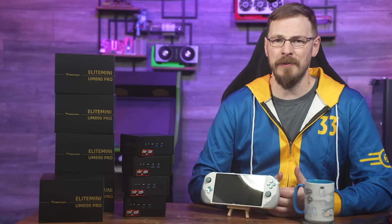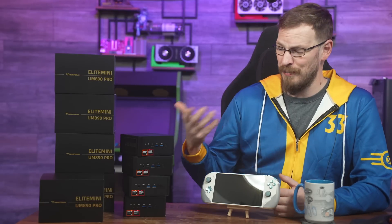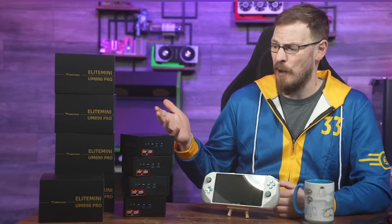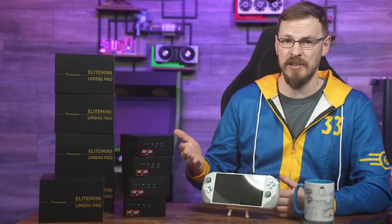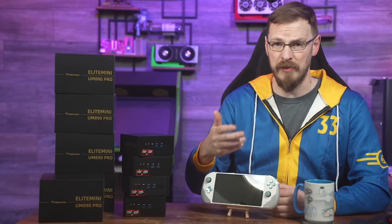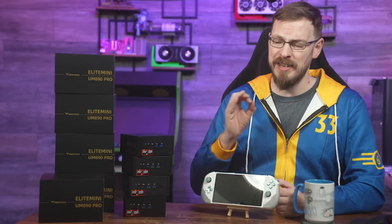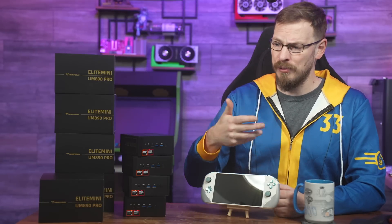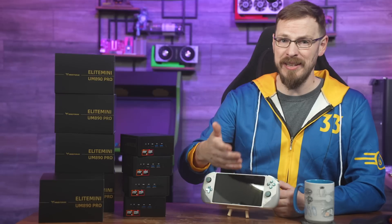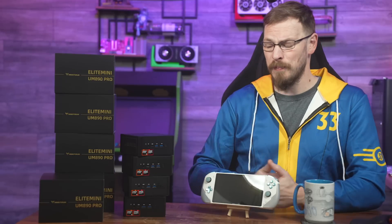A little bit of a different video, but I hope you enjoyed this glance behind the curtain at what I used to do for about 50% of my day job — speccing out PCs for specific use cases for clients. Sometimes it's not about finding the absolute fastest solution; it's about finding the best solution for your client and their specific use case. While we could have easily specced out $1,200 desktop PCs the second I heard CAD as a requirement, looking more closely at what the client actually needs and thinking about space constraints and workflow, these ended up being a pretty great solution and saved my client quite a bit of money.